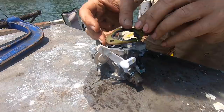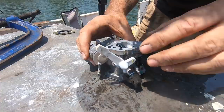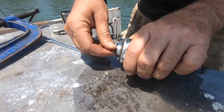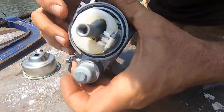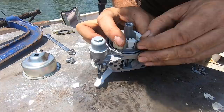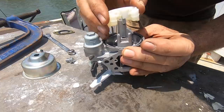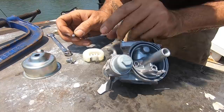Why are you leaking so badly, little carburetor? This is the bowl I took off in situ, just to make sure the float was working. A little pivot for the float — I mean, it's brand new. I really don't understand. And that needle and seat looks good — looks fine.